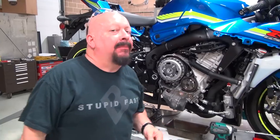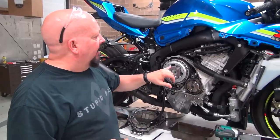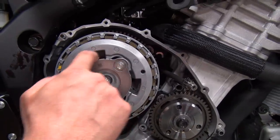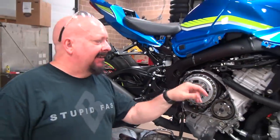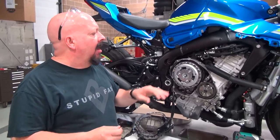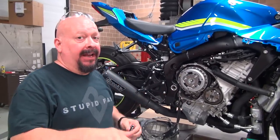One of the questions we're inevitably going to get is: Brock, do I have this type of clutch in my bike? Well, if you look — this only has three springs and there's a little ramp mechanism here. If your bike has this three-spring setup and ramps, you definitely have a slipper clutch. I'm going to pull this apart and show you what it does, show you how it works, and show you why it doesn't work so well for dead stop launches.